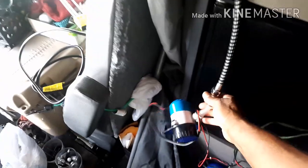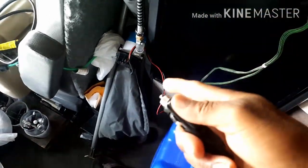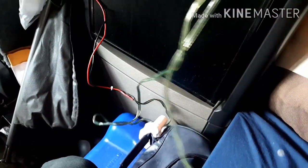I take the heater out and set it aside to cool off. Over here in this cubbyhole area is where I keep the pump and the on/off switch, which is just a lamp switch I got at a hardware store and wired in between the cigarette lighter plug and the pump. The cigarette lighter plug has a fuse in the tip to protect the wire, and I also put a fuse in-line in the circuit. I plug that into the cigarette lighter port and set the bucket up here on the shelf.